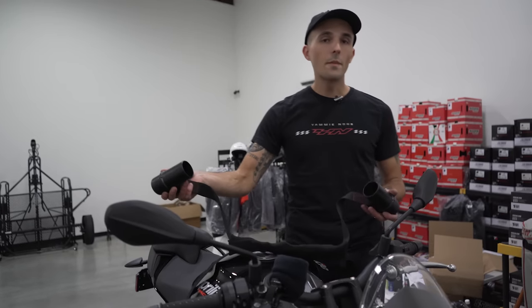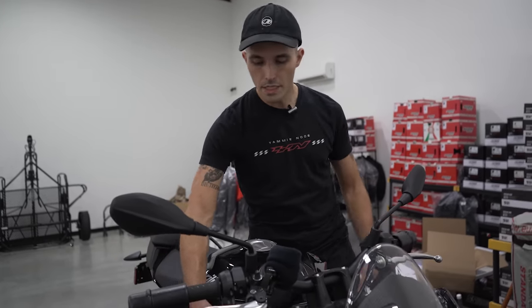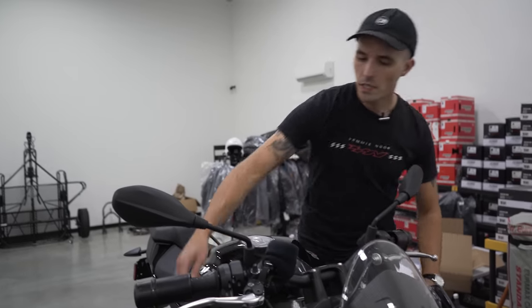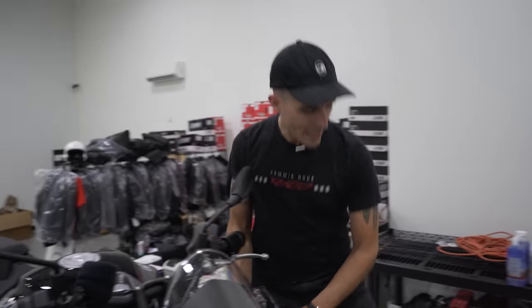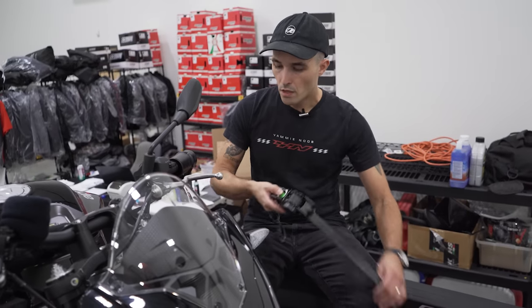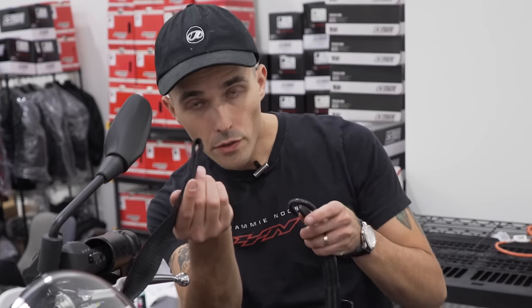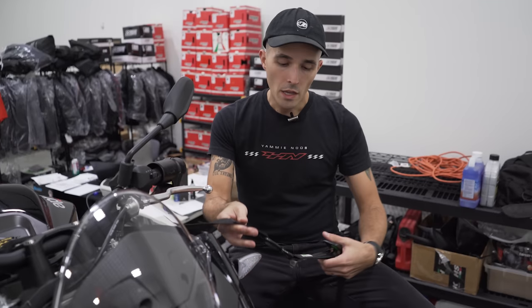Now you're gonna wanna take the cups from your canyon dancers and put them on the ends of your handlebars, just like this. This system works by one strap pulling this way, as you can see, and the other strap pulling the opposite direction. Now, you're gonna wanna take that ratchet strap that we chucked over here and start cinching it down. With the canyon dancers, it's really easy, guys. All you do is take this open mouth of the strap over here, put it in, use the pin, and that's it. That's all you have to do. You don't have to do any loops.